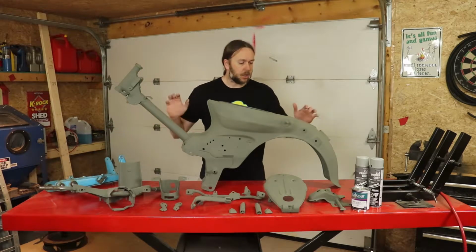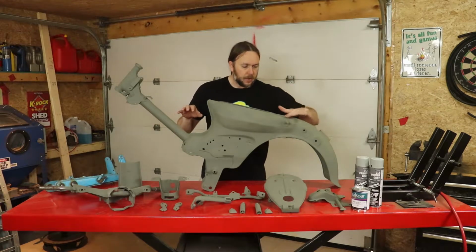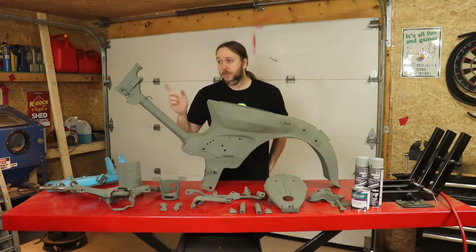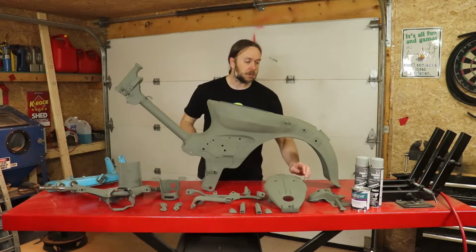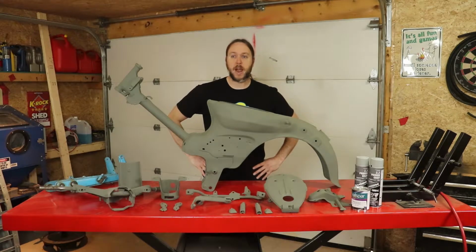We'll get that primed. We'll give this all a quick blast with air because it's been sat around collecting dust for a bit, and we'll get this stuff primed with the sealer primer as well. We'll give that 24 to 48 hours to cure up, and then we'll hit the HVLP sprayers, and we'll get everything sprayed so we can get ready to start putting stuff back together.